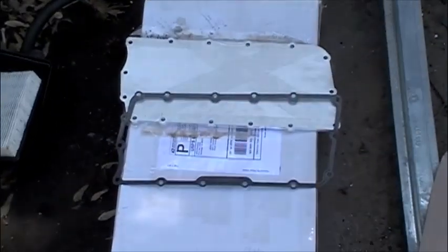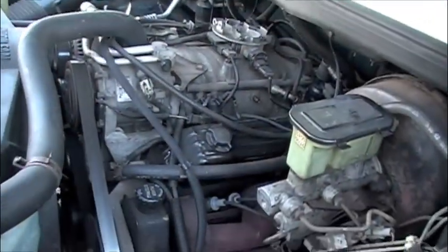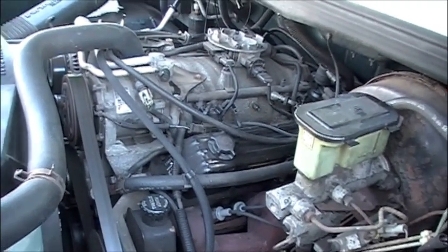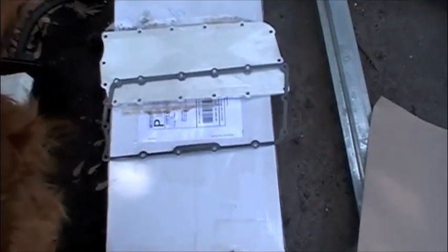This is a how-to repair video fixing my Dodge Ram. As everyone that owns a Ram knows, trucks have a common problem with the second generation: the plenum gasket tends to go bad. From what I'm told, the intake and the plate it sits on are different metals. In the winter the metal constricts, in the summer it expands, thus causing a breakage in the gasket.